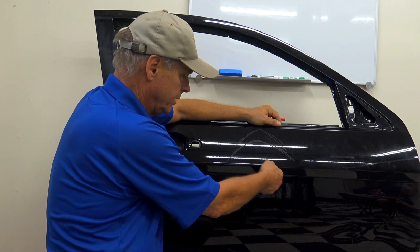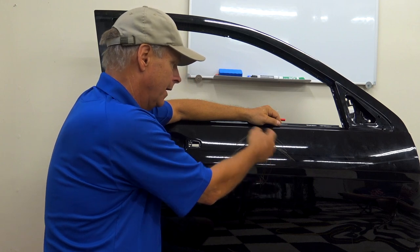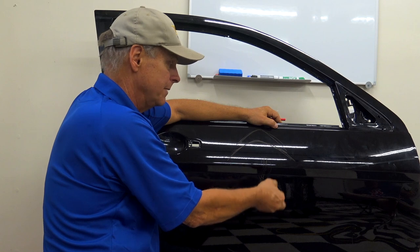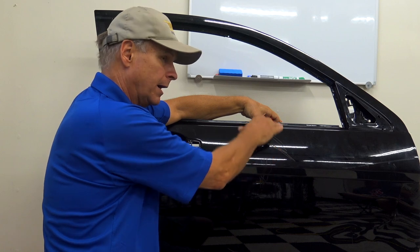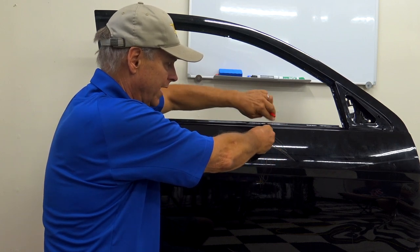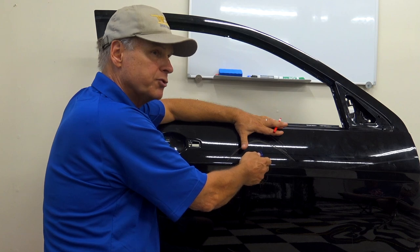I will put a small tab there, and I'll put maybe 100 pounds of force, maybe a little bit more on that body line, but I'm watching that crown constantly. That crown stops moving, I stop immediately, and I usually have one of these in there anyway. So I'll put a little bit of pressure on the body line, that crown stops moving, instantly stop. Put pressure on that crown, and I'm working that into the dent, just like I did if there wasn't a body line there.